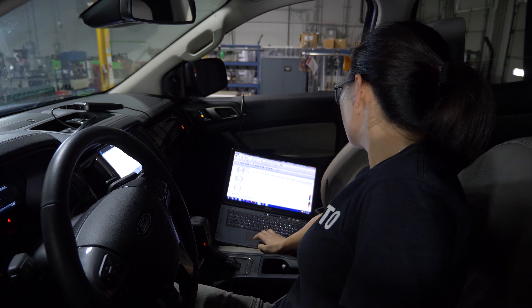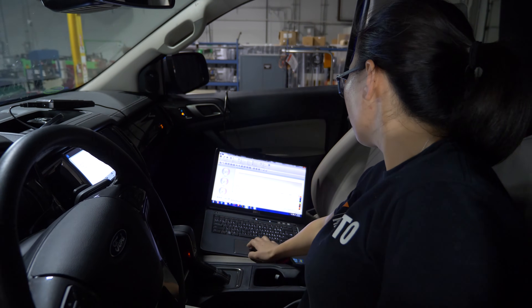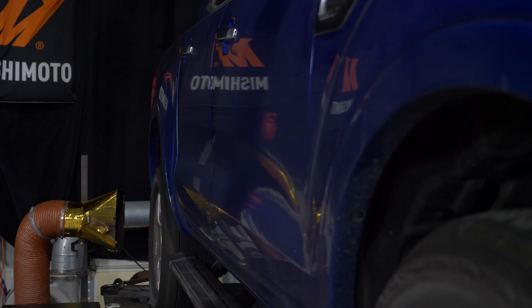The first testing is power pulse. We are basically putting our intercooler and stock intercooler at the same starting charge air temp and then we are measuring the power difference. Another type of testing is called heat soak. The goal here is to get the truck as hot as possible and then we measure the charge air temp and see if our intercooler has more capacity to pull out the hot air.